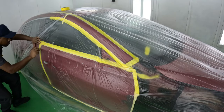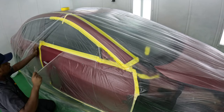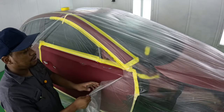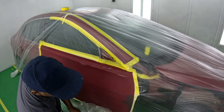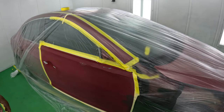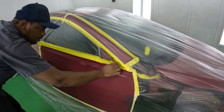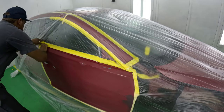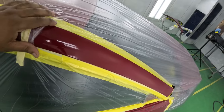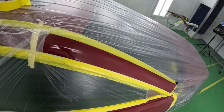You can cut it right in the middle or closer towards the panel you're painting, then just remove the plastic off the area you want to paint. It's always best to use a nice sharp razor blade to get this done as efficiently and quickly as possible. Then go over and do the same thing — mask off all four corners. You can choose to leave the plastic open and let the overspray go up under there, but I don't want the overspray in there, so I'll tape it.